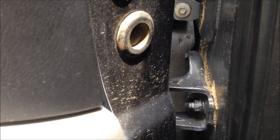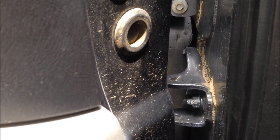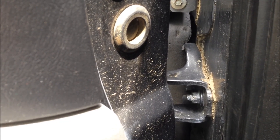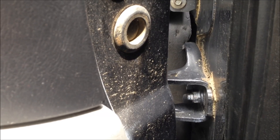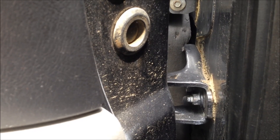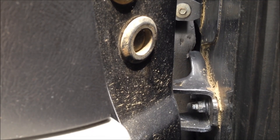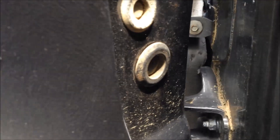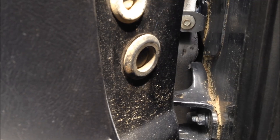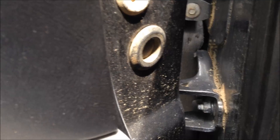Before I ran that sound baseline, I did not have those in there, so that also includes as part of that after-effect sound file. I really don't think it made too much of an effect, but nonetheless, if you want to reduce the in-cabin noise, I'll go ahead and try to find those insulating fender well sound insulators. I've got one on the left fender and one on the right fender, so make sure those are in there if you can. Or you can even fabricate your own — they're pretty straightforward.